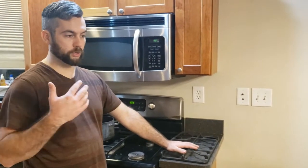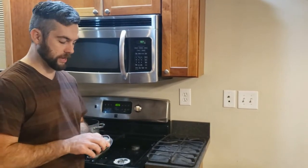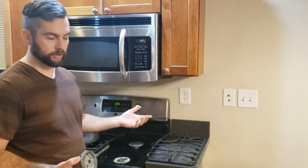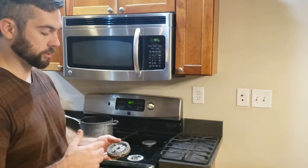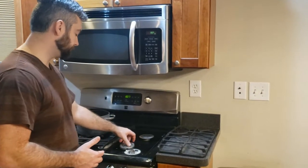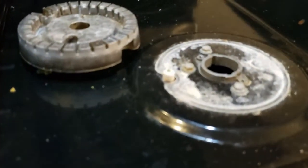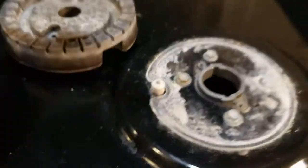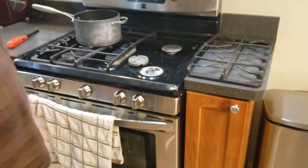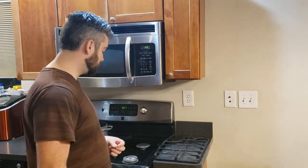So I hope that can help you out. If you know someone's having this trouble, tag them, send them the video — we could use the subscribers, we could use the support. This is a Kenmore stove, gas stove, but most gas stoves all work the same. They all have some type of little gas port, at least modern stoves, to allow the igniter to jump across and get a little fuel. So if that gets clogged, that'll be why you're using a lighter. The other reason would be your igniter, which is accessed from underneath. You can buy igniters at Repair Clinic online, get whatever igniter you need — it's simply bolted on with one wire. Anyway, thanks for watching. I hope this episode helps you, I hope you can help someone with it. Stay tuned for the next one.